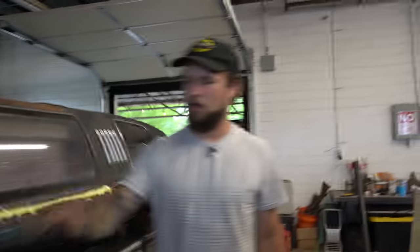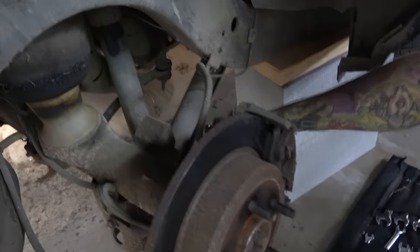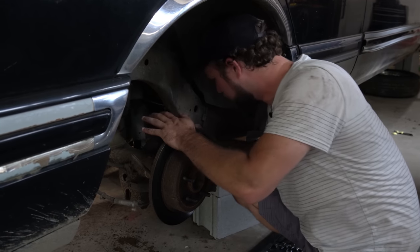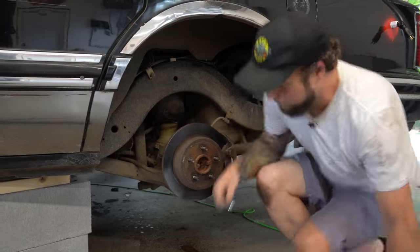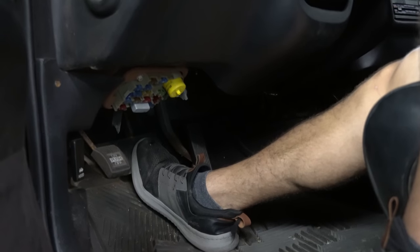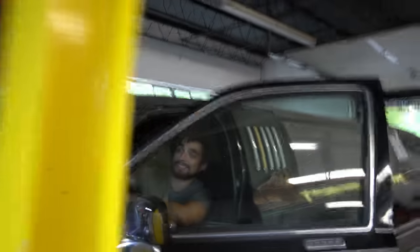I'll make sure it's fully topped off. I'll tell you to pump — hold the brake fully down — then I'll tell you to let go. God, these spiderwebs are insane. Pump her up — pumped and held — big release. Not spitting out any air. Literally no air came out — that one's good. A little bit of air on that one. That one's just dead. There's definitely air in that one so it's better than it was. The brakes will work but they're never going to feel perfect because there's still some air in there. That feels firm though.